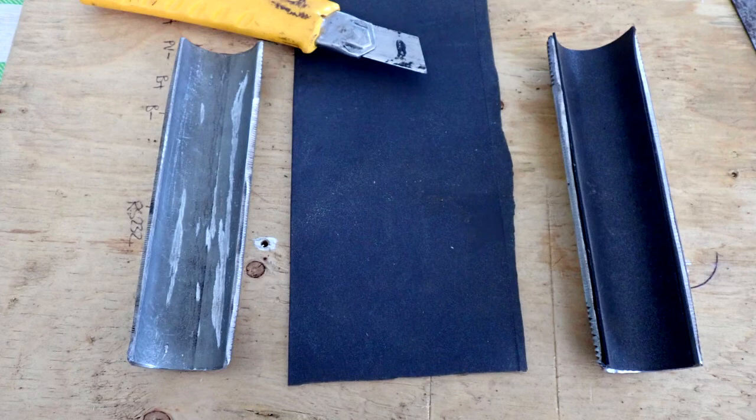Here's the six inch nipple cut in half lengthwise — I did that with my metal cutting horizontal band saw. It's a good idea to put some rubber or insulating material between this galvanized steel and the aluminum of the bumper, otherwise you're going to get corrosion and it's basically going to wreck your bumper.